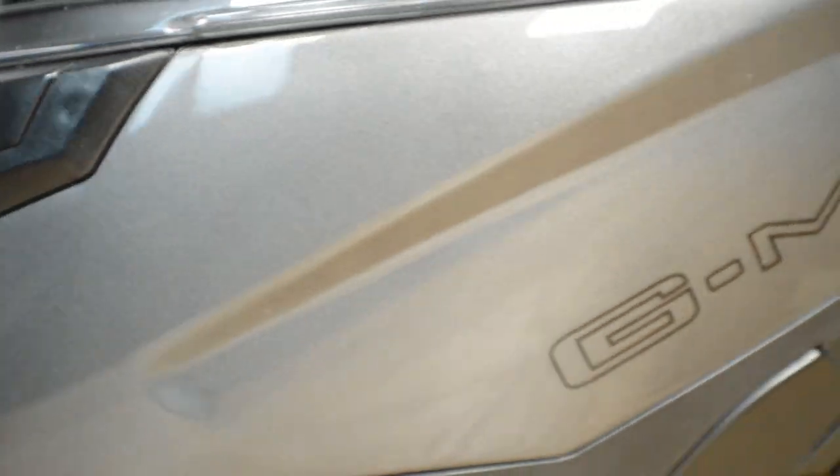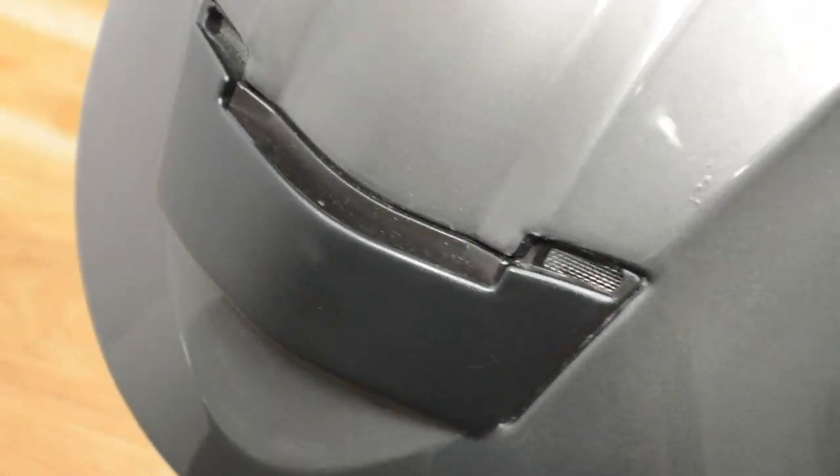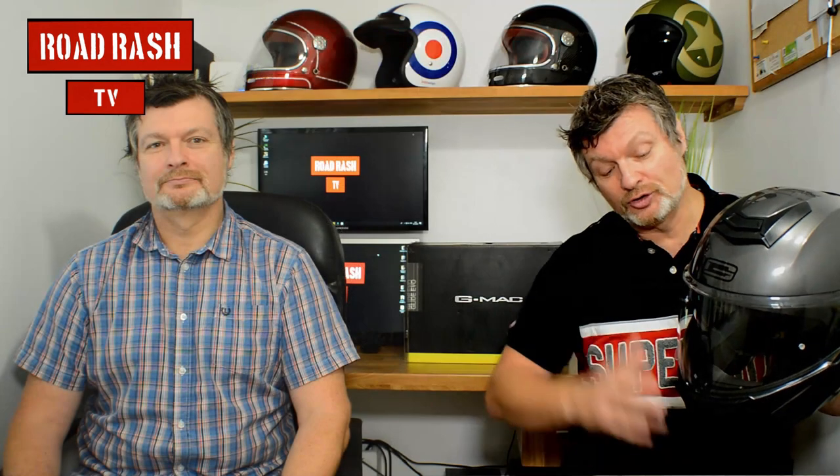Given this is a flip-front helmet, that's pretty light when you consider that most other flip-front helmets on the market tend to weigh about 1,750 to 1,850 grams, especially at this price point — I've seen some up as high as 2,000. Now one of the other things I wanted to talk about was the ventilation system on this helmet, because it's top-notch. Down the front here we have an open-closed chin vent, and we also have another little button just underneath which slides up or down depending on where you want the airflow directed. In the down position it flows air up towards the visor, keeping the visor clear, and in the up position it pushes more air down towards the chin area to keep your chin cool. On the top of the helmet we have a twin air intake operated by a little slide on the top, and we also have an open and close exhaust vent at the back. This creates a venturi effect when opened, which helps to suck the air through the helmet. And this helmet also comes pre-installed with Pinlock inserts.